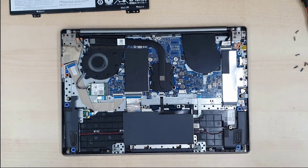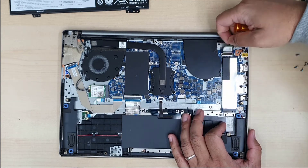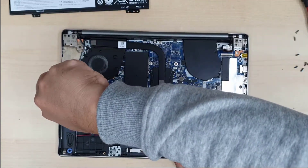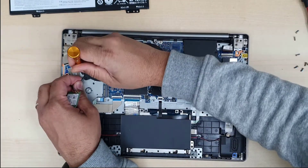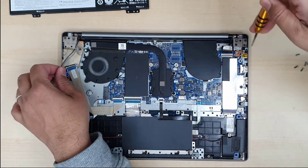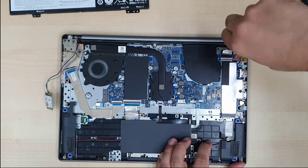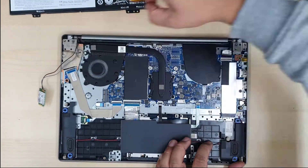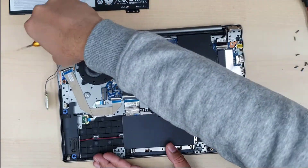In this second step, our main focus is to pull out the motherboard. We have to disconnect all the flex cables very carefully because a lot of them are very fragile, delicate, and sensitive. We also have to remove all the screws — remember those screws are different in size, length, and thickness, so you can make a kind of diagram to keep them organized. There are also a lot of flex cables and long wires — speaker wires, trackpad — and we have to pull out every single component.